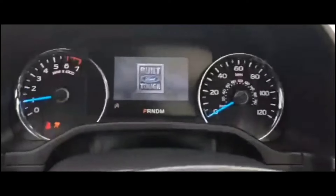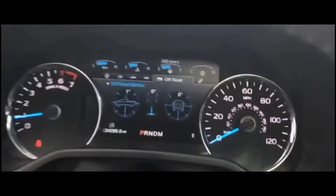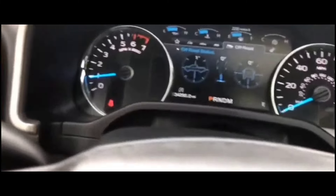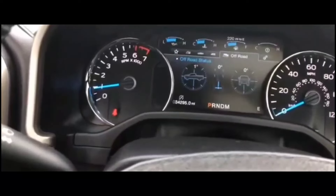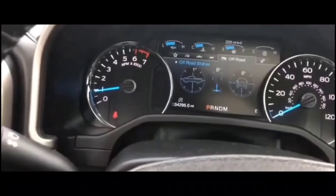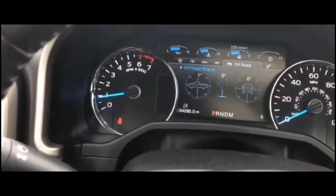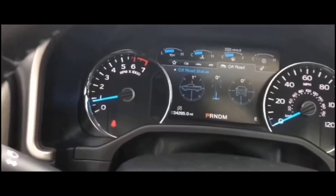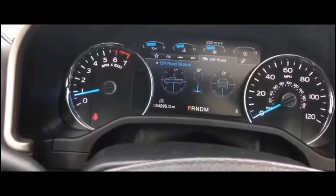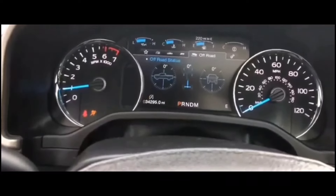At that point I was thinking normally I would try to get a jump. However, I did not get a jump because I did not think it was the battery. The battery was replaced about four months ago, the headlights were bright. So what I did was I looked at the terminals to make sure the battery terminals were clean and tight, which they were.